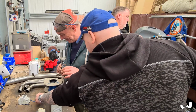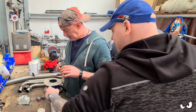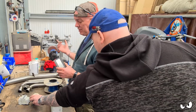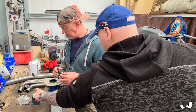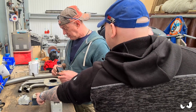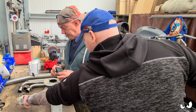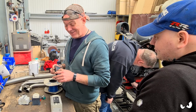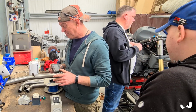A proper start and stop button on it. And an emergency stop. Because I've just got that little box. It's literally a box with a go and a stop button on it. A contactor just for the safety side of it. And then the breaker, a 3-phase breaker. So the little mill is getting a major upgrade, which is going to be sweet.